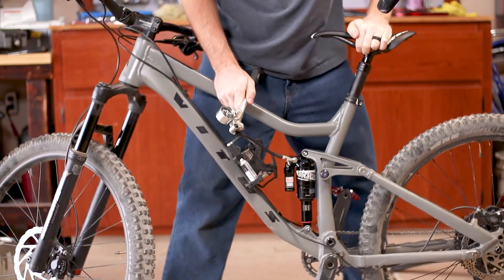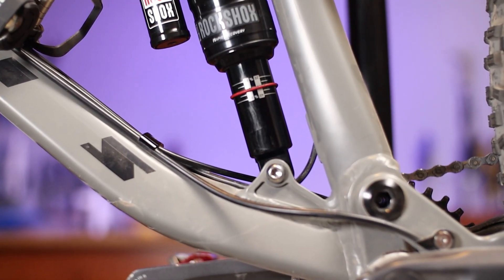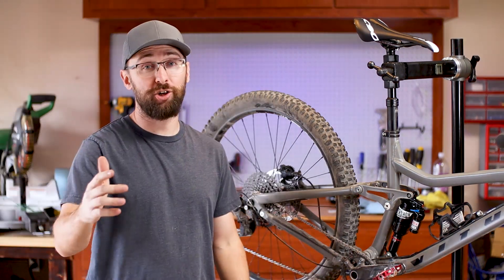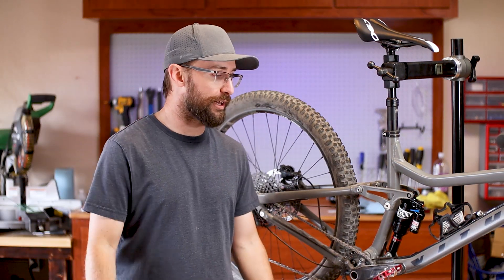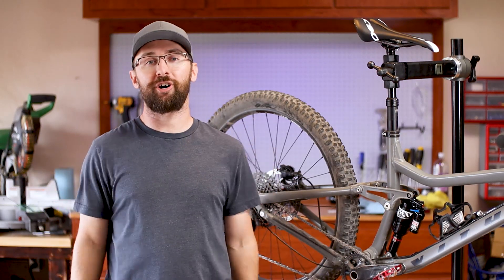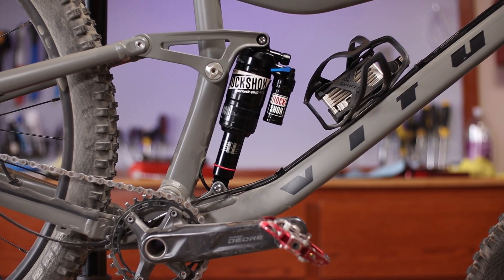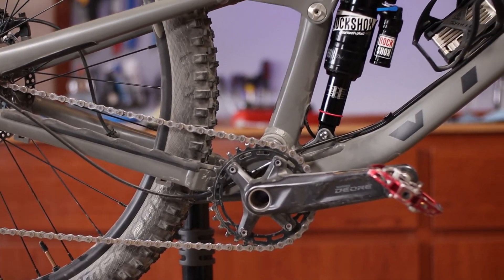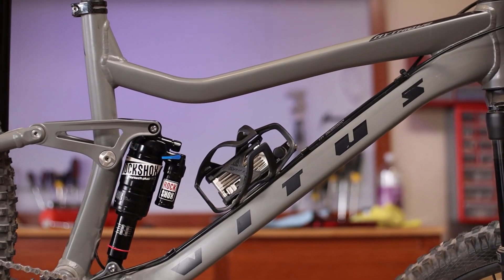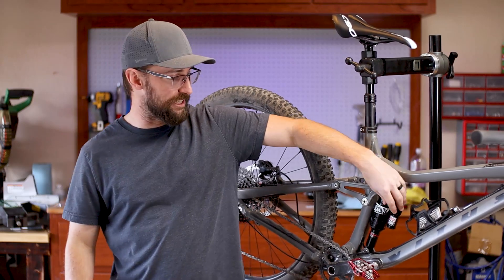The RockShox rear shock is completely rebuilt. Put about 200 psi of air in it, checked the sag and it was perfectly at 30%. Right when I wrapped this up, it actually started raining, so I'm not going to be able to ride for you guys at the end of this video like I usually do. But if you want a real-time ride review video this weekend, let me know in the comments down below. I successfully took this shock — someone else's trash basically, a shock that retails for about $500 — rebuilt it myself, and now I have a high quality shock. I can say that this shock is super plush feeling and I really like how it has the pedal lockout.